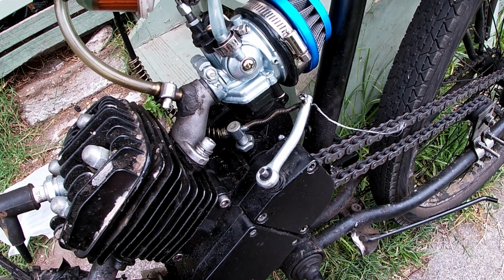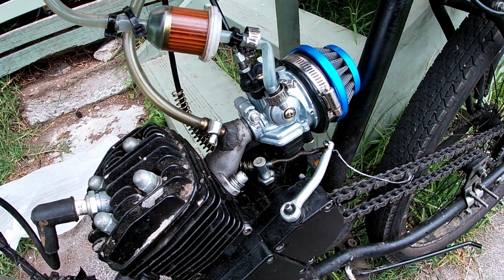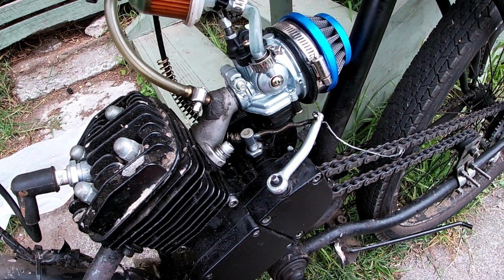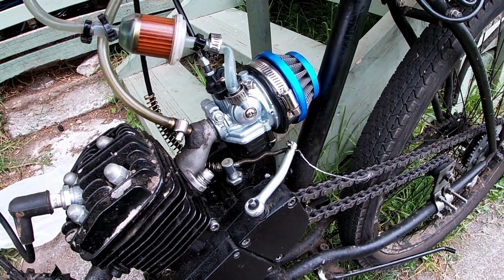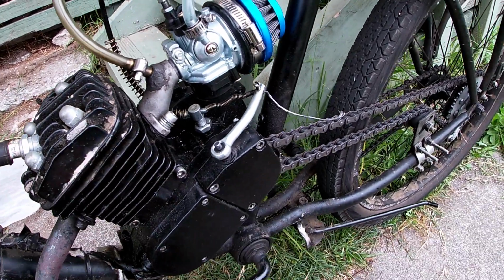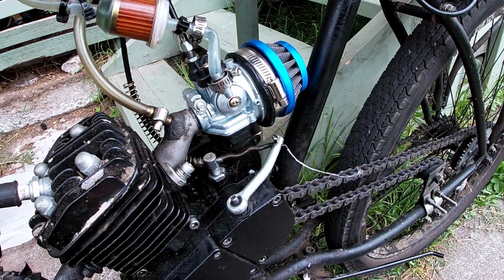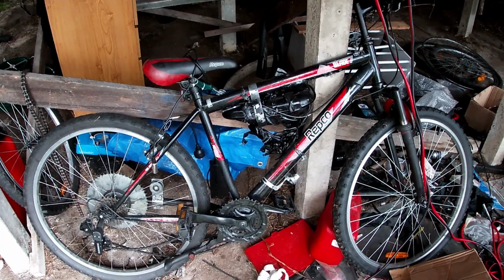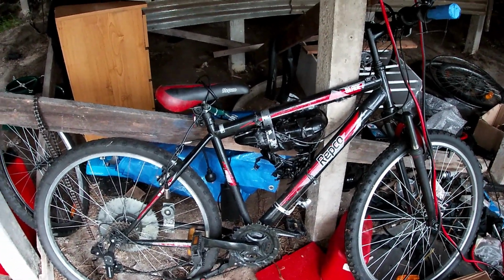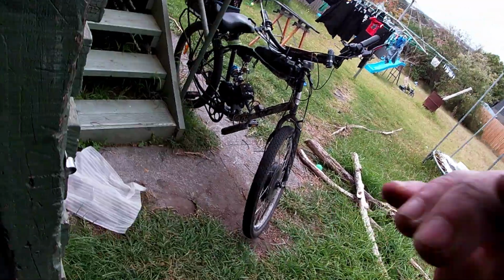So what we're gonna do is we're gonna take all of this off, we'll sort out that leaking float bowl, and we're gonna get rid of the boost bottle before changing anything else, so much as pulling the spark plug, because I wanna see if, in fact, this boost bottle is robbing that low end torque. But yeah, we're going to decide once and for all whether or not the boost bottle is a hindrance or a help.